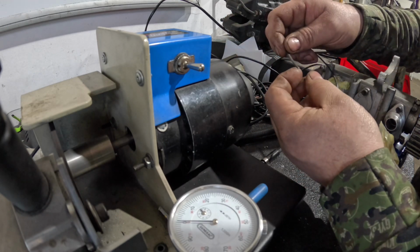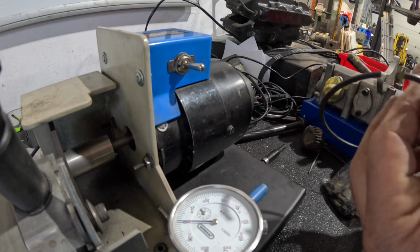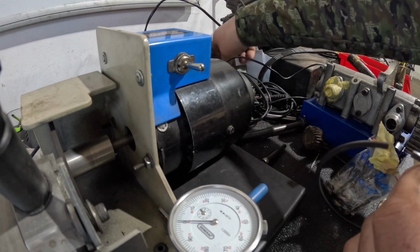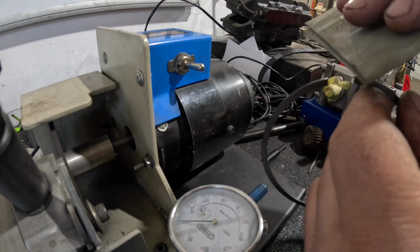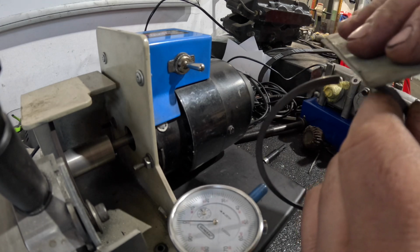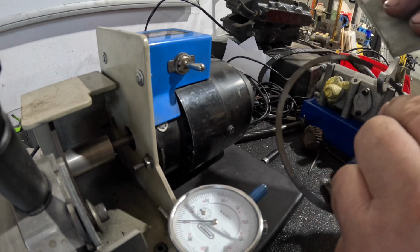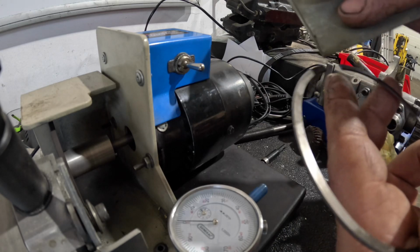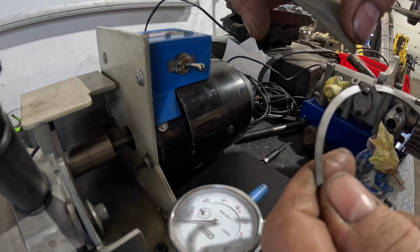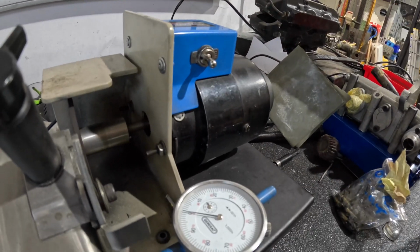Like that. And then the top. And then the part that runs up and down on the bore, I'll do that by hand with a really fine bit of emery. Making sure I keep the sanding action in the right direction, and then just clean up those 2 parts as well. And then back to the block.